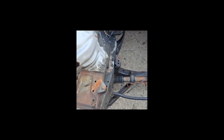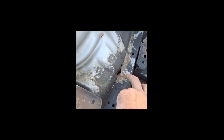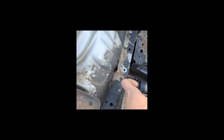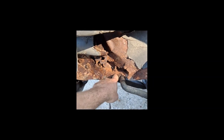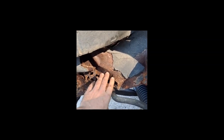These are not traditional frame rails — they're made up of layers of sheet steel, typically thicker than your floorboards, however this is just the inner side of the frame that makes up three-quarters of it. The other quarter is just sheet metal on this side, and boy does it rust out through here on these cars. You can see this is usually how they get, but even as rusty as this car is, the frame rails are still very solid — it's just the real thin sheet metal side of things that gets crusty, which is why these cars are still usually very savable even when they're completely floorless.